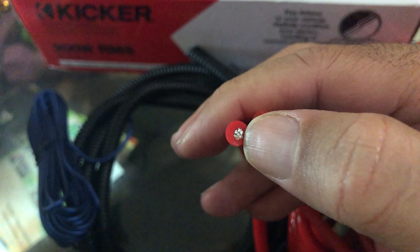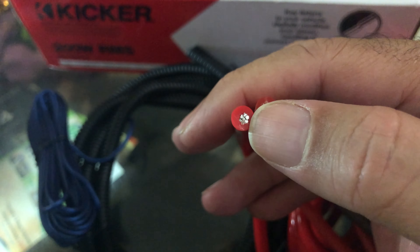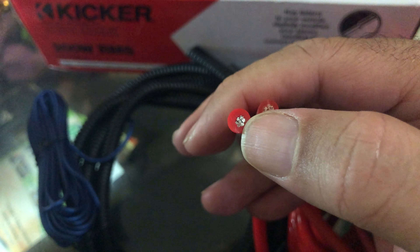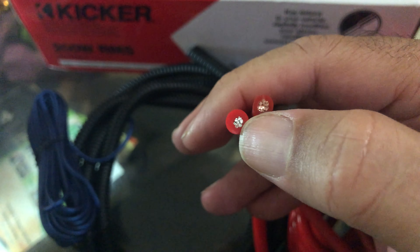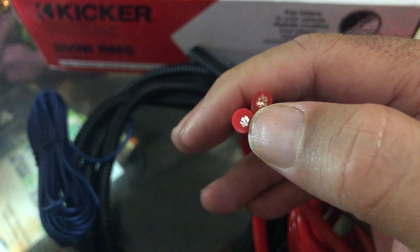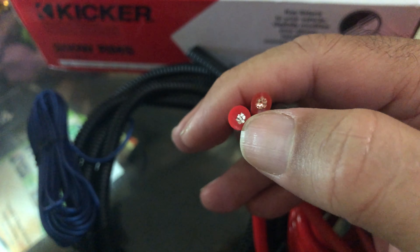This CCA stuff — the reason I've got this warning out there, a lot of people might hate it, but I've got to warn you guys. This stuff is going to heat up. It doesn't have the same conductive properties as true copper, and it is not the actual gauge thickness. So if you ran this back 17 feet into the back of your vehicle from the battery, you've basically got yourself a fire hazard, because if I'm drawing the true 30 amps, this thing's going to put out the equivalent of 10 amps of heat.